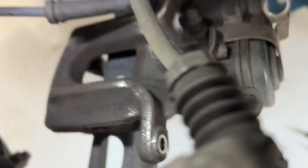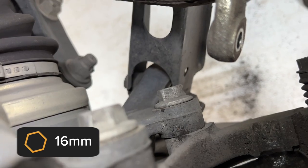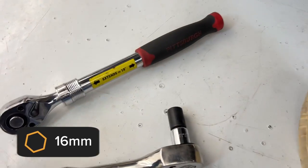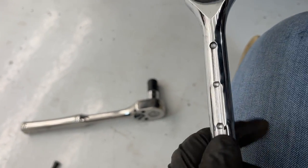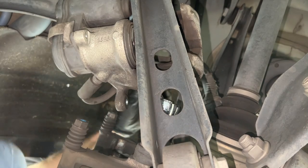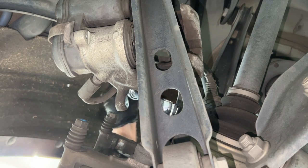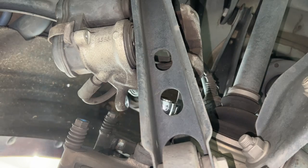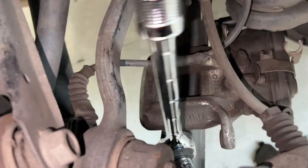On the back here there are two bolts holding this bracket on. You can see them both right here and they are both 16 millimeter. They're going to be on there pretty tight, so I have one of these extension bars that allows you to apply more torque, and a 16 millimeter socket. I have the wrench on bolt number one. You're going to want a long bar here or your life is going to not be nearly as fun.